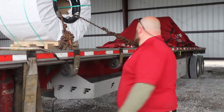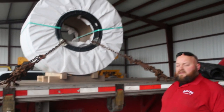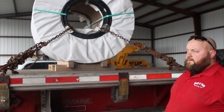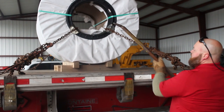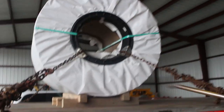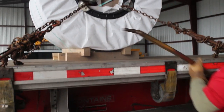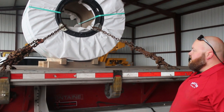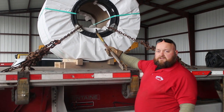Now it's time for our black tarp. If you're pulling a bigger coil — say one that's 37,000 pounds — the minimum load securement is going to be four chains. You'd put your other chains one here to here and one here to here. If you had one that was just one pound over 18,800, you would just put one more chain right here.